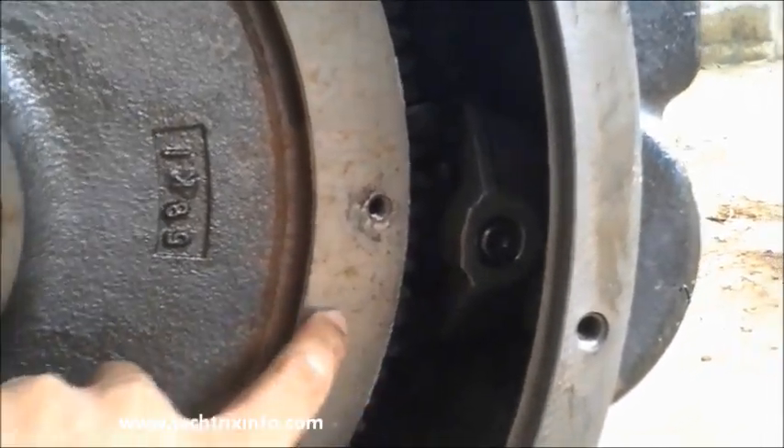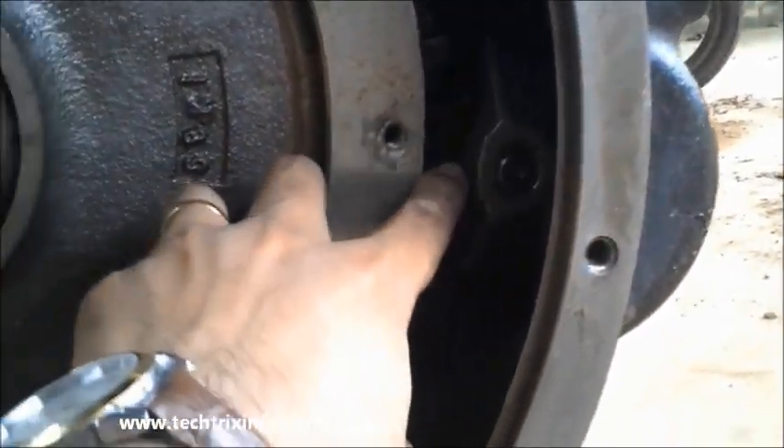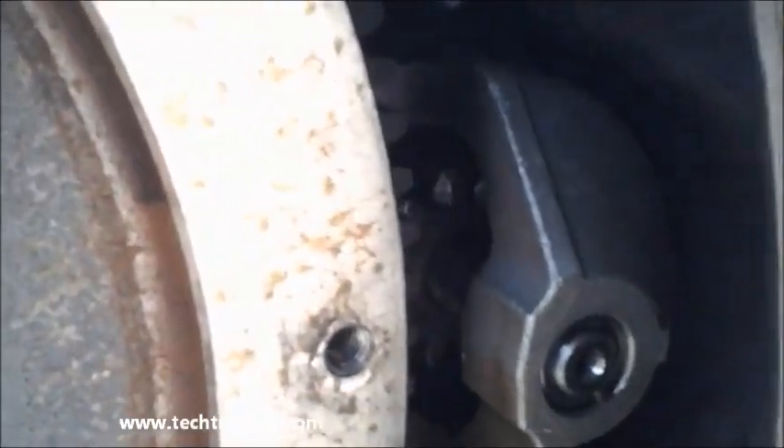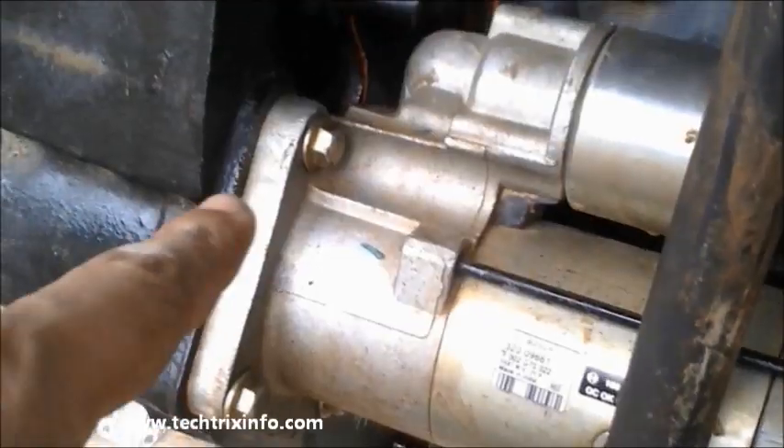See, that's the point where it all happens. When you start the ignition key, the power from the battery reaches the starter motor, and that small pinion gear gives the drive towards the bigger one — the flywheel. The flywheel starts rotating, and as it gains momentum, the smaller starter motor gear goes back. That's the starter motor over there.